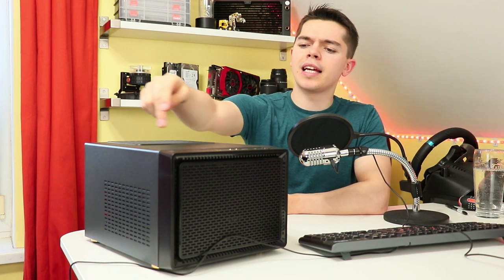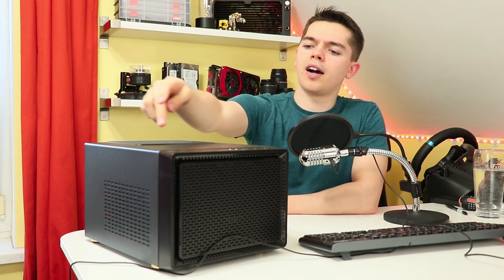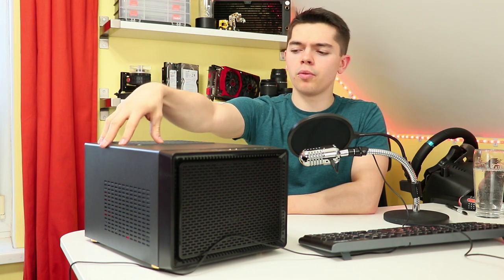The 280mm graphics card compatibility, although technically it measures 280mm, generally graphics card manufacturers don't measure tip to tip. They sort of have a central zone. So although this card is sort of heading to the 270 zone in terms of its length, I really wouldn't recommend much more than that, because scraping will happen. And if you really want to go to 280, then I literally can't see a way you could fit it in. You'd have to bend the chassis.